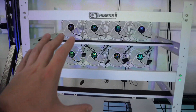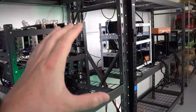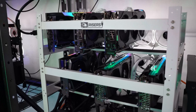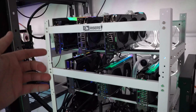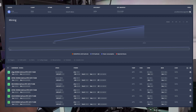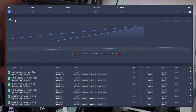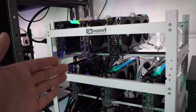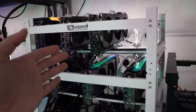I've been in a rush to get all the cards up and going before transitioning them into proper frames, but I hope you guys enjoyed this video. I'm glad I got these 3070 Tis up and going — please drop a comment below if you have any questions. I'll include a screenshot of the overclocks: it's a 215 watt power limit, 2500 memory clock, and a 900 core lock — though I might be off on one of those numbers so refer to the screenshot. If you guys use different settings please let me know, I'm interested in getting these more efficient. Have a great rest of your day and we'll see you guys tomorrow.